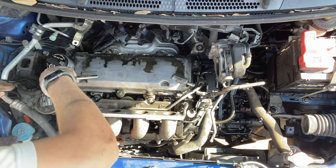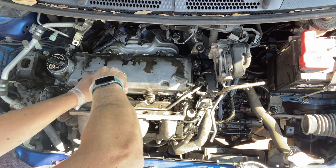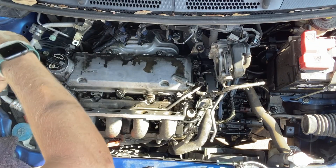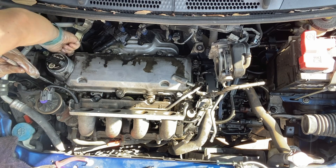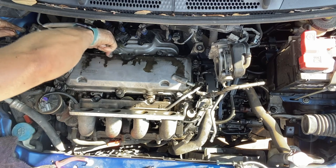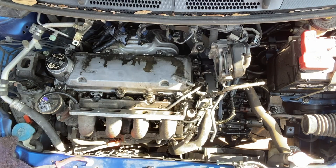This was not the correct pattern, but I was just trying to not have the focus in one area when I was pulling off the valve cover gasket bolts. And then it comes right out. One of them dropped and I cursed, but I removed that.